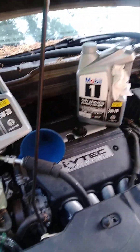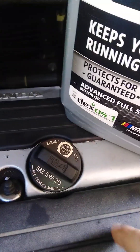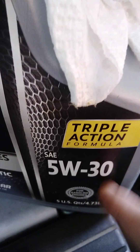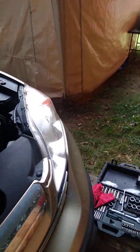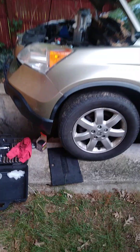Now this cap usually tells you what you should put in the car. The car is kind of older — I talked to my mechanic after hearing the car making a bunch of valve train noises, and he recommended putting in 5w30 to calm it down. When I did that it was a lot quieter — it stopped making those valve train type noises, stuff rattling in the top part of the engine. So I'm not going to do 5w20, I'm going with 5w30 again because I trust the guy. When I put it in there it quieted right down, and I've been working with him for 20 years.